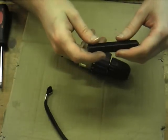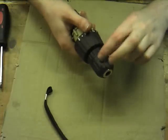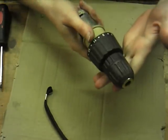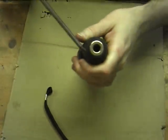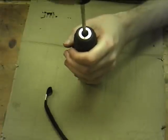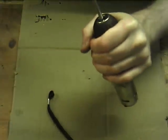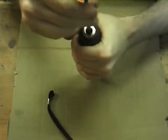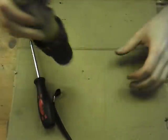Likewise, you have the matching die set as well, in case you wanted to do something with the chucks. Anyway, the thread would obviously unscrew if you're running it backwards though. So they've got a screw down the centre, which you probably can't see, and that has a reverse thread on it. So you have to turn it as though you were going to tighten it up. Oh. It's loose. It's the first one of these that's been loose. Just turn it until you hear it start jumping on its thread.